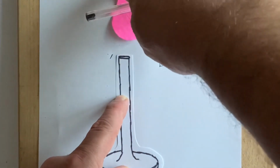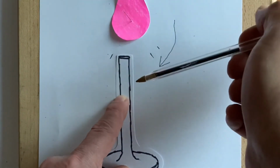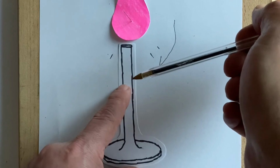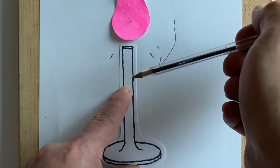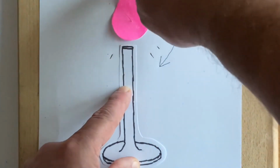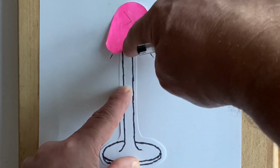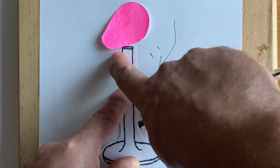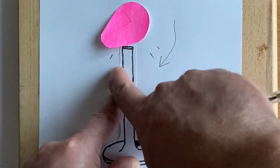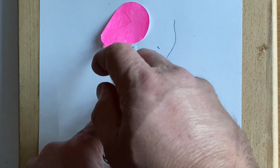Let's just move the camshaft away, and I'm going to reduce the gap back to what it was before. So there we go, with a smaller gap, and I'll turn the camshaft around again. I won't go through the motions of completely opening the valve, let's skip over that. But hopefully you can see it's going to get to that point there before it starts to actually close.